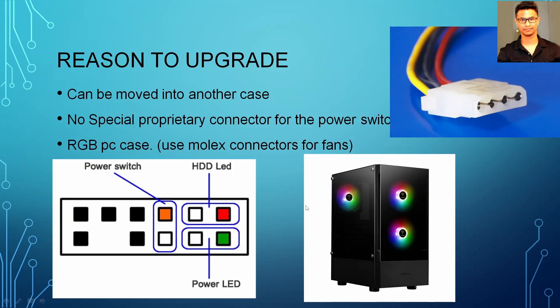I will show you the diagram of how it works. As you can see in the front panel diagram, on the bottom left corner, this is the front panel connector for the Dell Vostro 260. For your power switch, you connect these two pins. Your HDD LED goes up here and your power LED goes up here. There is no reset switch, and you don't really need it — if you need to restart, just go to the Windows icon, click power, and then restart. It's not a big deal missing the reset switch.